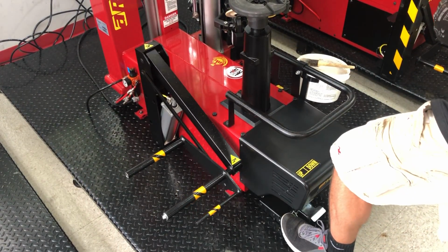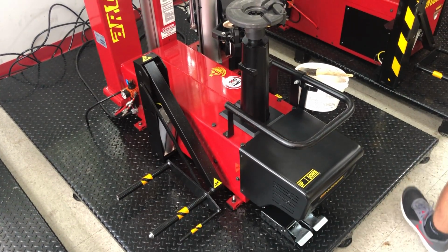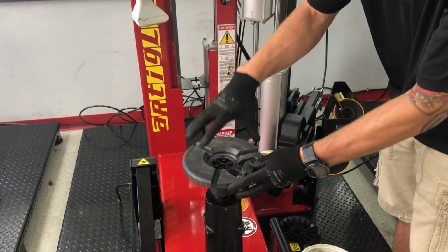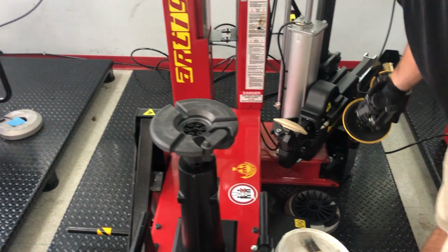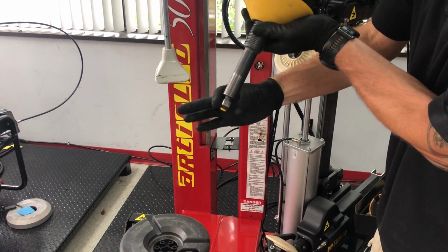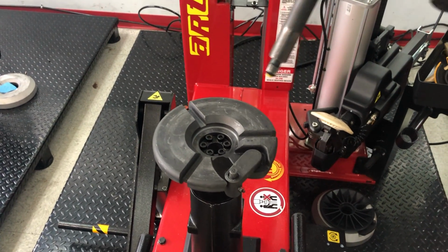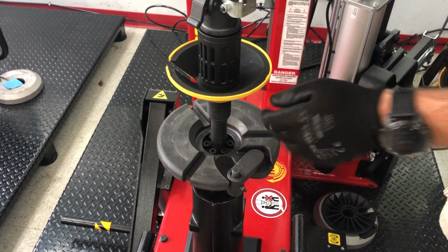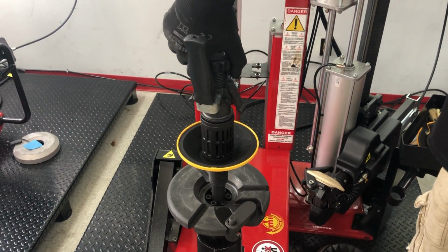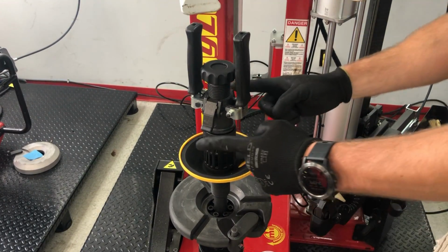Right here you can see, for our heavy wheel assembly, we have a turntable, new generation, so it's not a ring clamp, as you can see, it's a center lock. So how this operates, actually we will use this locking pistol. As you can see, we have a flat side on this, and inside we will have a slot. Basically we will insert this, of course our wheel would be sitting there. We rotate it until it falls in. After that, another quarter turn clockwise. You can see this is now locked.